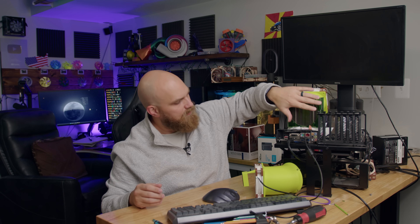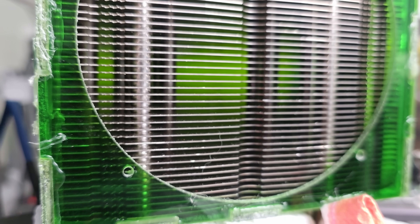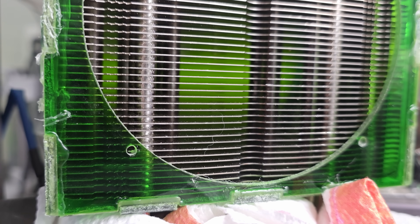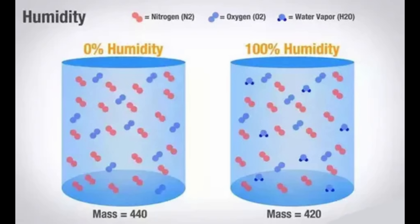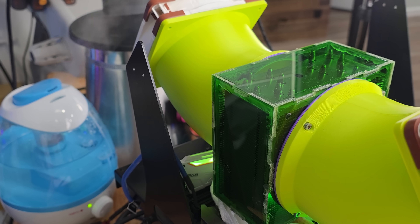Anyway, back to our experiment. I took the front tube off to check if there was any condensation inside the fan stack — I didn't notice anything. Normally we think of humid air as being less efficient at cooling CPUs or any heat sink, and that's because water vapor is lighter than the nitrogen and oxygen molecules it displaces. So it's less dense, and less dense air means there's less mass flowing through a heat sink per second, which carries slightly less heat.